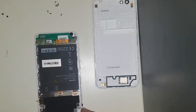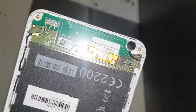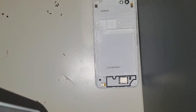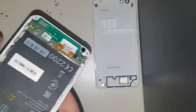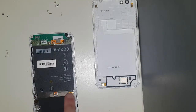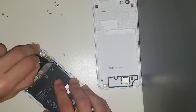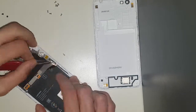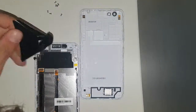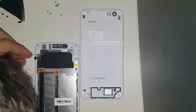What I said before about this phone being dropped too much — here's some evidence of that. There's a crack on the PCB, though I don't know how this will affect the screen. I think this is the LCD connector, so I'm going to pull out the label to take a look underneath. The cable seems to be okay.